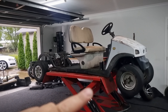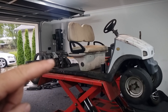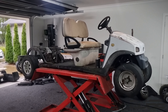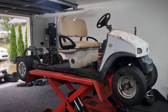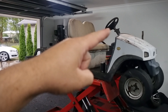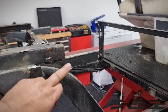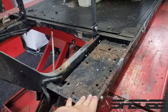As you can see, we've whacked the roof off it. That upper support was so rusty it ended up snapping off. We're probably going to do some roll bars across both seats just for safety, and we might do some side intrusion bars as well that can open and close — that's not a given, just a thought for now. We might do a removable roof and have it a lot lower, but we'll definitely be putting a screen back on somehow. For anyone who lowers things, this is an absolute dream — have a look at how big that rear C-notch is. The chassis rails are really solid — there's no rust on them. It's all the areas where water was trapped that's gone rusty.